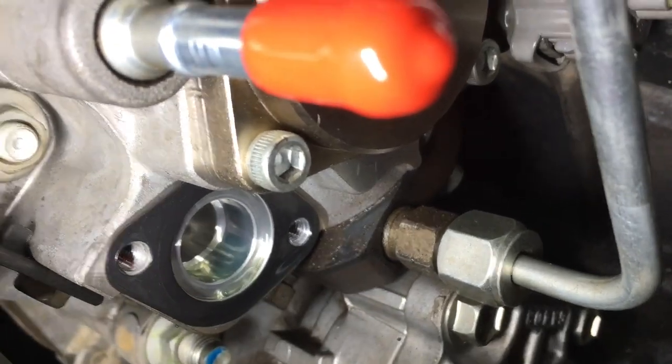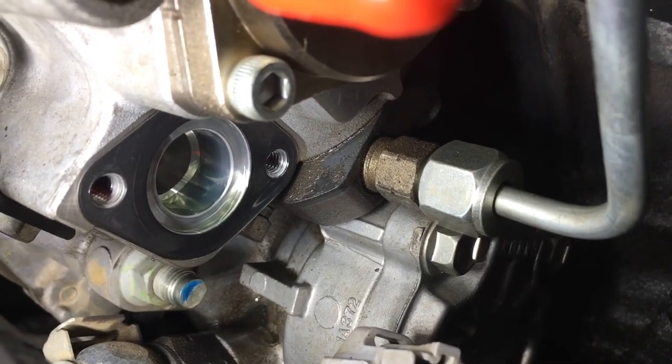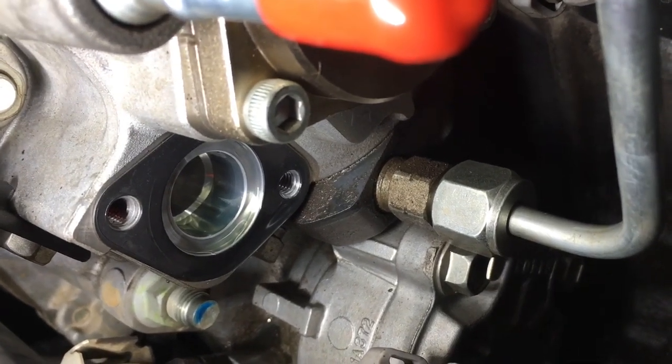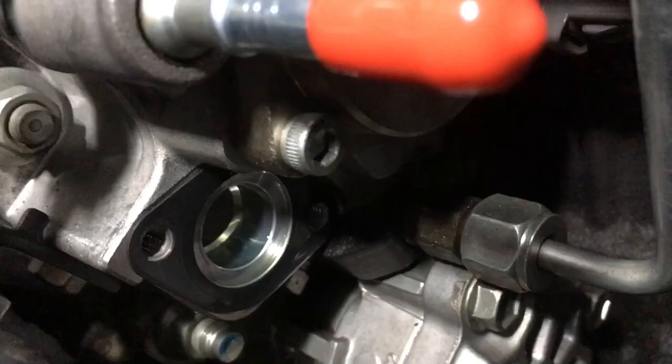While we're at it, let's have a look as much as we can. Let's pass this light down in here — that's what it looks like in the back of the pump and where your gasket is. So if you don't touch the gasket it'll just stay sitting there ready for reinstallation. But check it directly before you pass the new one in there, because it could fall off in the meantime. Just have a look at it with your light directly before you put it in.